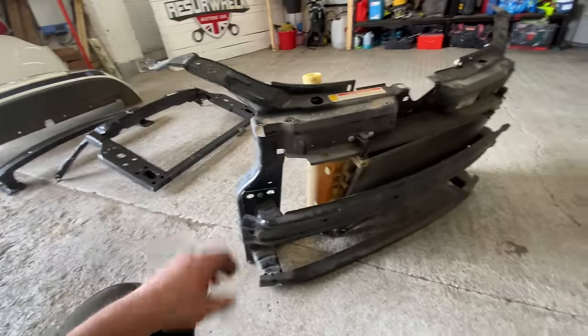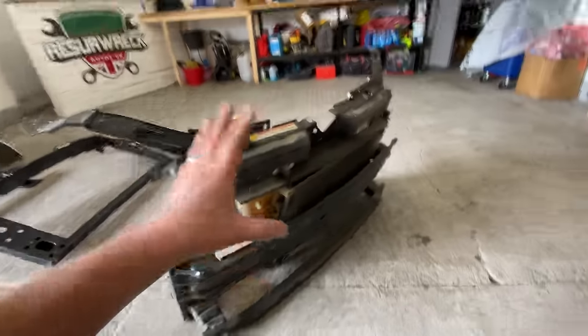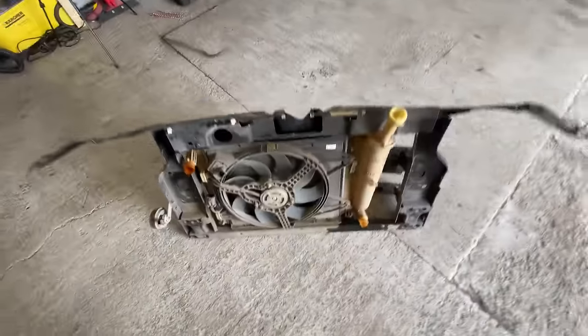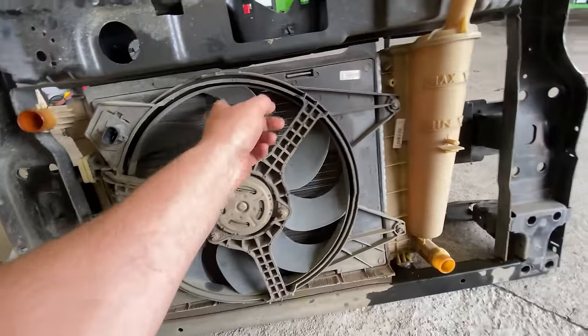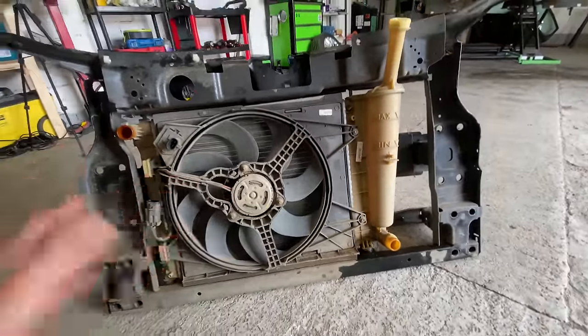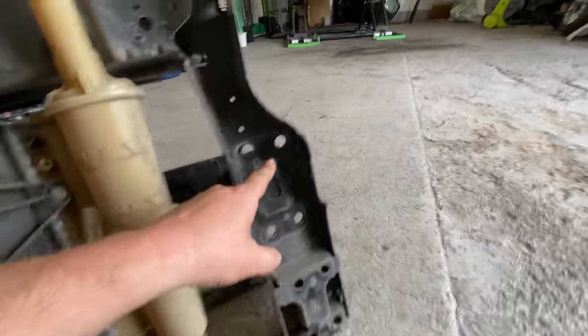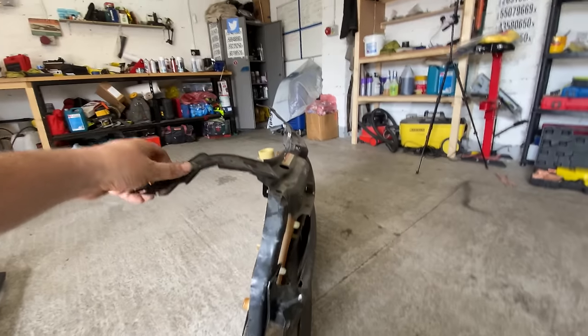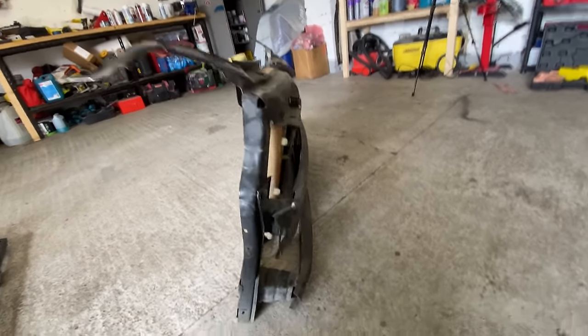And there's nothing in the panel. But luckily enough, my radiator pack, air conditioning unit, is all holding fine, so I don't need to change that. I'd rather use as much of the original as I can, because then it's the original parts that I'm using. And the fan spins without any problem at all. So it's just a case of swapping over the whole section, really. But yeah, got really lucky with that. And you can see that obviously the slam panel's here, and where it got bent up. None of the rest of the panel, apart from obviously the top wings, are bent up a little bit like that. But that's just normal for that kind of impact damage, really. But yeah, there we go.